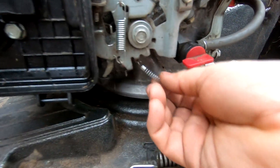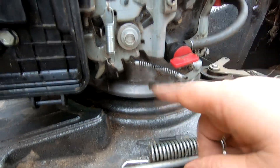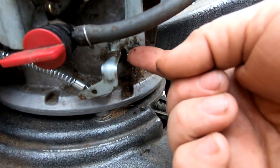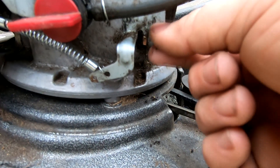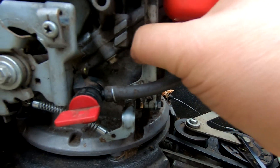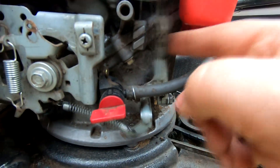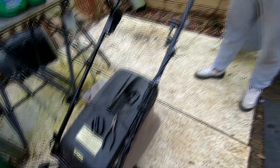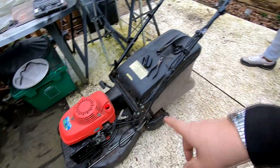The opposite effect now - I had to stretch a spring because I didn't have the right one, so now it's ticking over too low. I've already set the governor arm up. The way you do that: you undo that nut on the back there, you've got a little half-moon shaft coming through from the engine, you get a pair of pliers and turn that clockwise while you have the arm in the back position, then nip that screw up and that should be the governor arm in the set position. But we haven't got enough tension on that spring now. We were going to start it up again but being an old lawnmower the cable snapped, so we've tried to source another cable but haven't got one for a Honda.